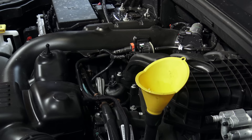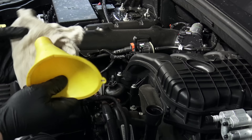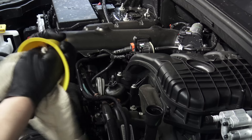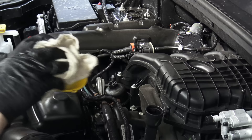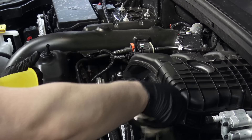In case you're wondering — I get this question a lot — if you're changing the oil for the first time on a brand new vehicle, I recommend doing it at 3,000 miles to get all the break-in debris out of there. Thereafter you can do it at 5,000 miles and be just fine. Personally I like to stick to 3,000 miles on my own vehicles, but 5,000 is perfectly fine on these. These newer engines have a lot less blow-by dirtying up the engine oil.